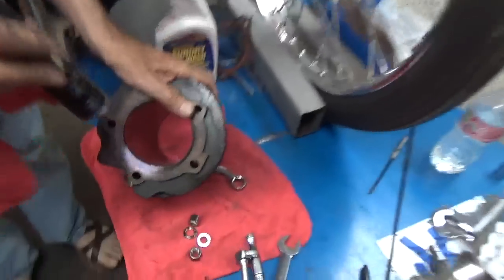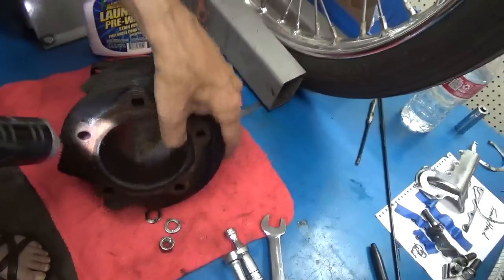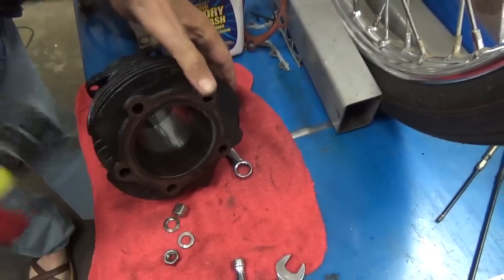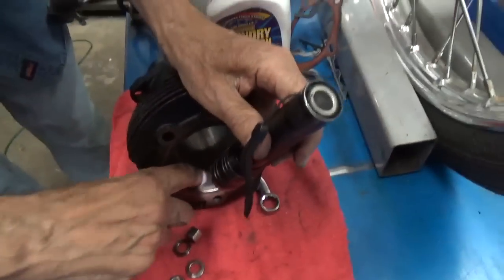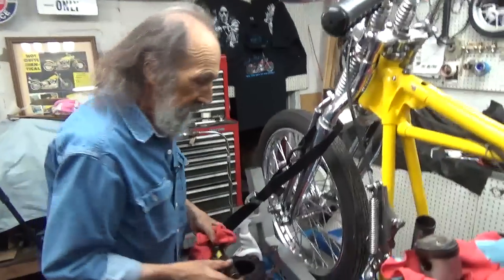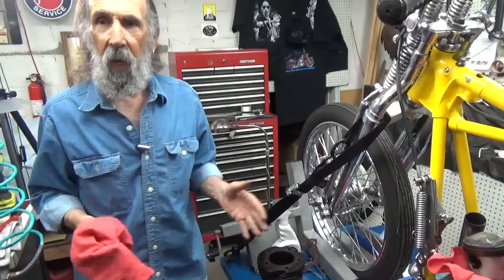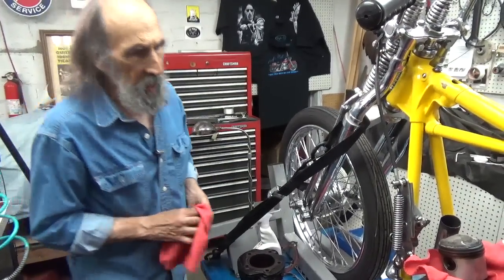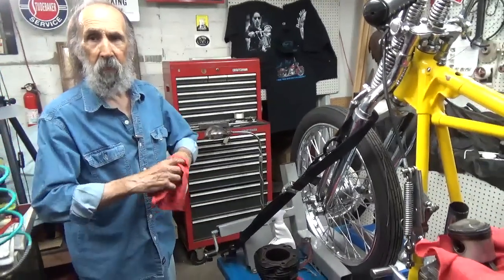I don't like these scores, but they're not bad scores. We've got some hashing right there — what I'm concerned about is things like right there. They're not bad, they really aren't. I'll take tomorrow when I come down here — if it's not too hot — and I'll measure the cylinders and the pistons. I'm pretty much sure that a real nice fresh cross-hatch in there, honing that cylinder and putting a nice new set of rings on these pistons, which are going to be scrubbed within an inch of their life — that's got to help with that vacuum in there. It absolutely has to.